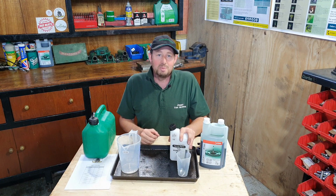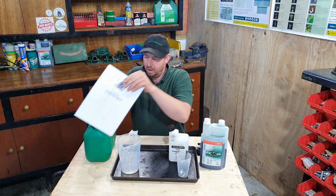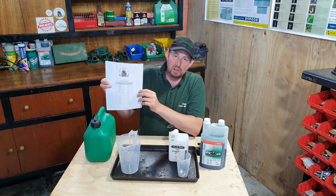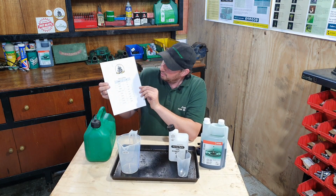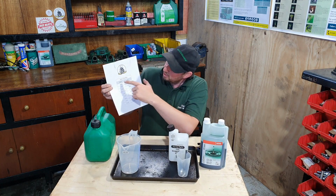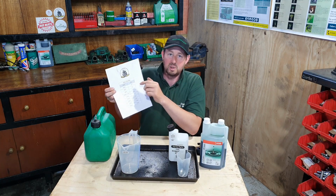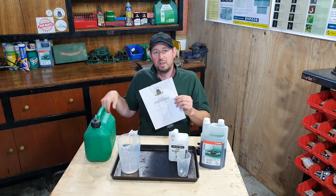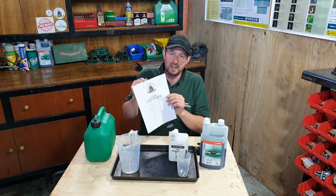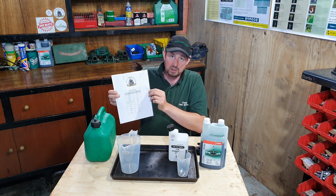Let's have a look at how we mix it then. I put a handy little chart together and that's available to download from my website. The link will be in the description underneath. So we're looking at a 50:1 oil mix. The reason why I'm choosing 50:1 is the main brands like Stihl, Husqvarna, people like that, they generally run on a 50:1 petrol to oil ratio.